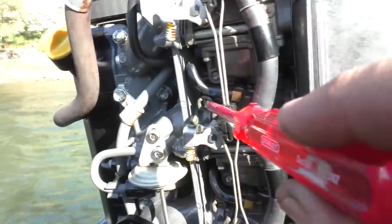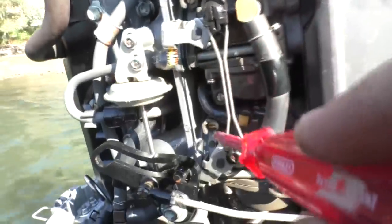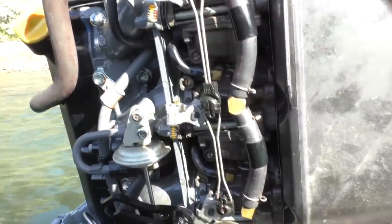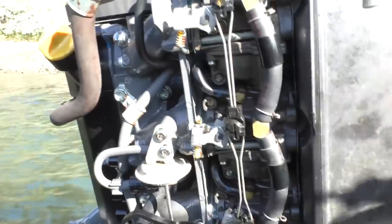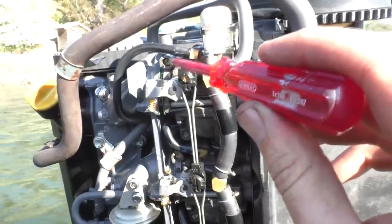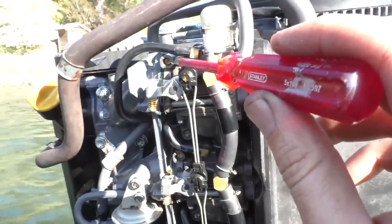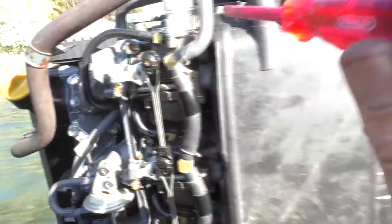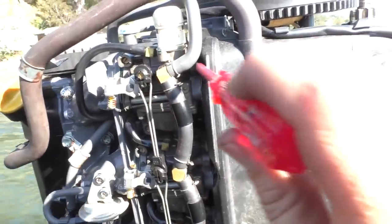This is the one for the first carb, this is for the middle carb, and this is the one for the bottom carb. Now these are fuel mixture screws — the more we wind them out, it's like a tap, and as you pull it out you're opening an aperture and letting more fuel in. The reason we know these are fuel mixture screws is because they're at the engine side, or the intake side, of the carburetor. If they were at the airbox side, those would be air screws.